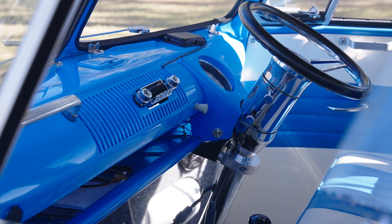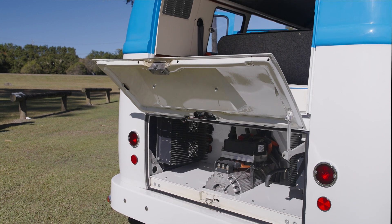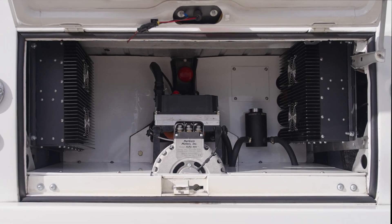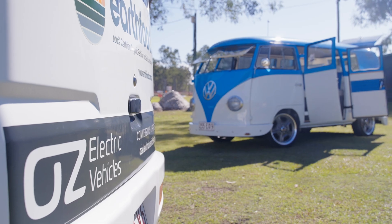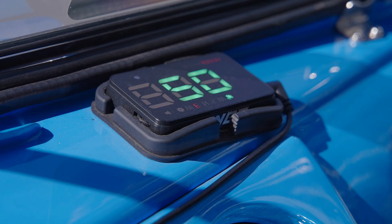Additions of four-wheel disc brakes, power steering. We added air conditioning in this car, which is a big ask. We've used a 144 volt Hyper 9 with a 750 amp controller — it's more than adequate for the car, considering it had something like a 1300cc motor before. The owner's happy, goes great.